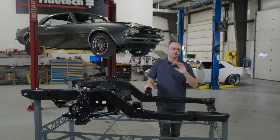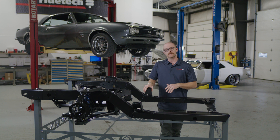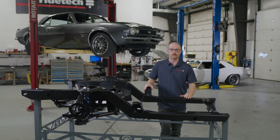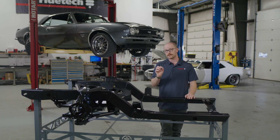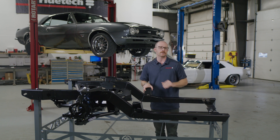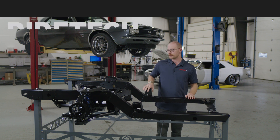We understand that results may vary. If you have a different set of wheels you're invested in, just know you may have to modify the vehicle a little bit to make that work. It may not be conducive to spend a lot of money on brand new ForgeLine wheels, but that's what we've had the most success with. You may also be able to play with wheel spacers a bit to knock that tire and wheel combination out to get into the sweet spot.